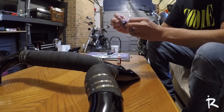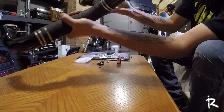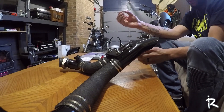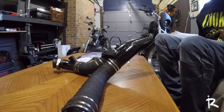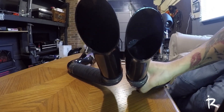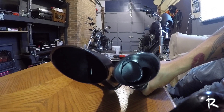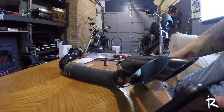First things first, let's get all the materials out. Put the washer on — it already has a nut on there — then get the washer on top. I ended up having to fill one of those holes I drilled with some JB Weld steel stuff. Throw another washer on and put just a dab of thread lock — it also helps lubricate it so it's easier to slide down. Screw it on until it's almost tight and set your position. I got the torque cones in; they're slightly open so a little bit of air can come through, but the purpose is to increase the back pressure. Next step is to get these put back on the motorcycle and see how it sounds.